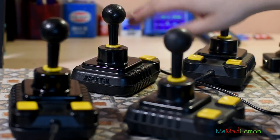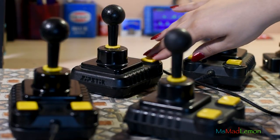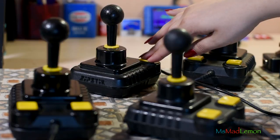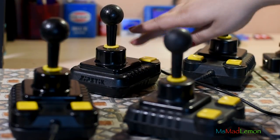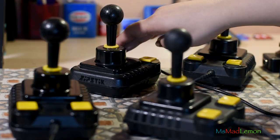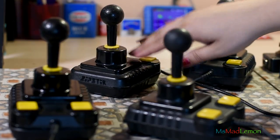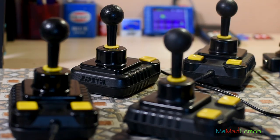This one at the back is actually fine. I did replace the microswitches on it, except the fire buttons are harder to press. I think the buttons just need elevating up so they're easier to press. Other than that, I will test this and see what the actual issue is — something just didn't feel right about it, so I'll be looking at that also.